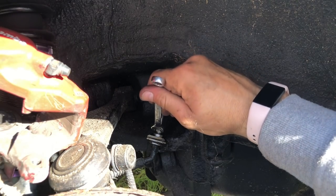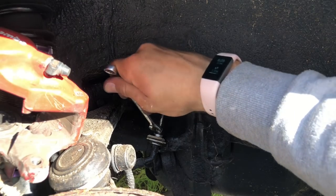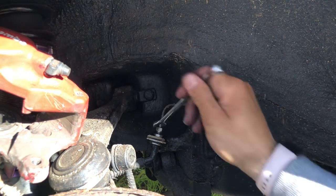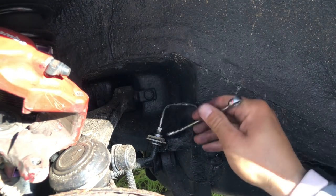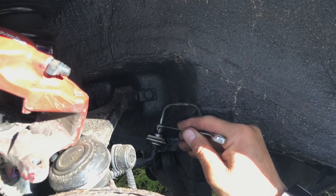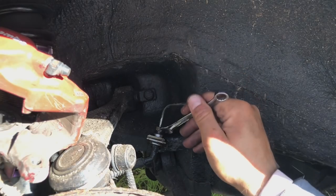Well, that's the result. That one actually cracked off. That heat and lubrication obviously helped out massively. So that's going to save me a lot of time, so I won't have to flare a new fitting on there, get that brake line straight on. Because it's not a nice job having to flare a new fitting on there with loads of brake fluid coming out of the pipe.